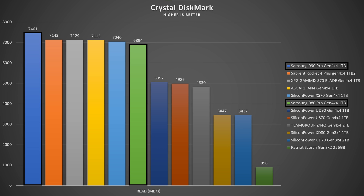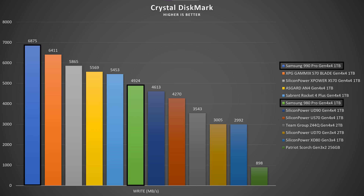Let's also check out some M.2 speeds, which I didn't test on the Steel Legend. The Samsung 990 Pro 1TB, which is a Gen 4x4 drive, in CrystalDiskMark reached a read speed of 7.4 GB/s, getting close to 7.5 GB/s, while the write speed hit 6.9 GB/s — which is outstanding for what is considered a lower-grade motherboard.